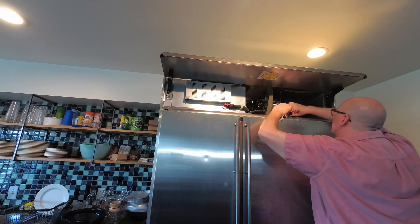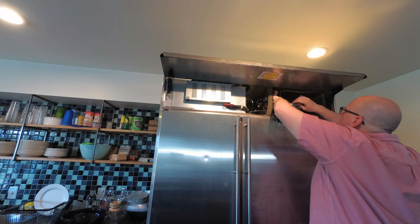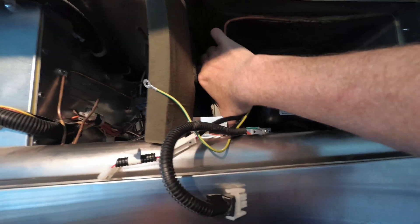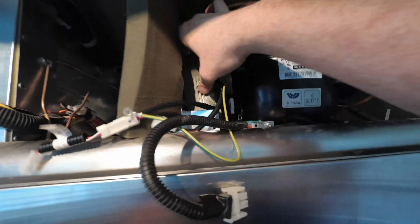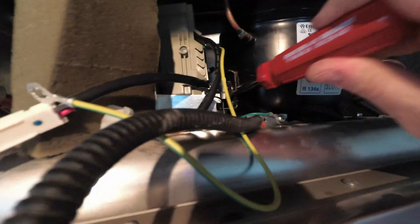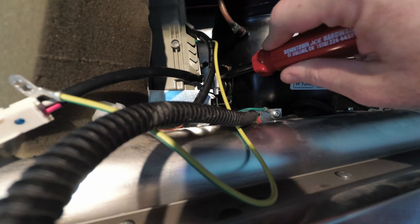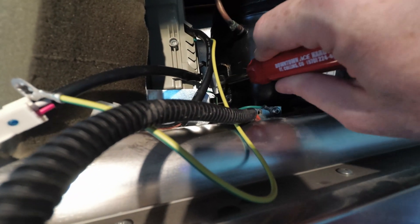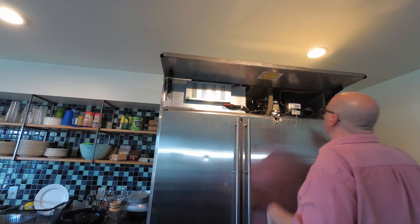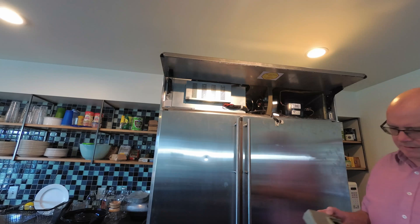So the sudden realization — this is not the first time it's been replaced. Once you loosen that lower screw on the inverter box, you can lift it up and to the left and it'll come loose. Behind there is a connector, and you can use a blade screwdriver to carefully pry it off to the left, prying it off toward the compressor body. Once you do that, it's free and you can pull it out.